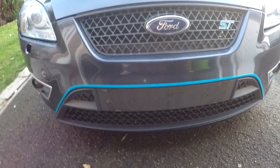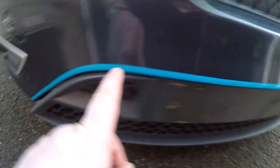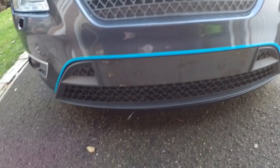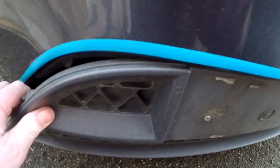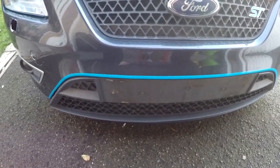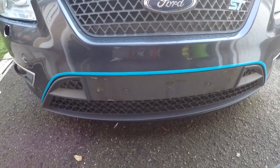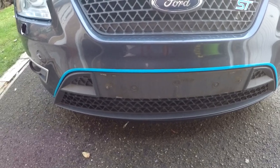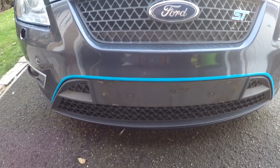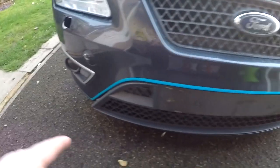Getting this front grill off is quite difficult. As you can see, I've pulled away this first edge — clips all the way around — so it is fastened really hard. Now there are three ways you can do it. You can do it the way I've done it, just pulling the corner out and pulling it bit by bit, but that will snap every piece of it so you won't be able to fasten it back in place. If you're not bothered about refitting it that's fine, but if you want to get it out neatly you're probably gonna have to take the whole bumper off so you can get to all the clips and undo them properly.